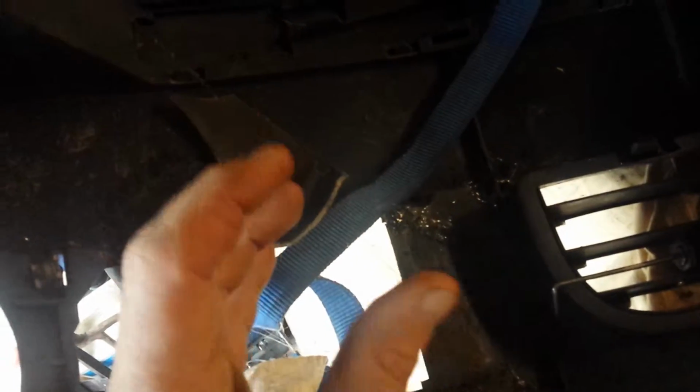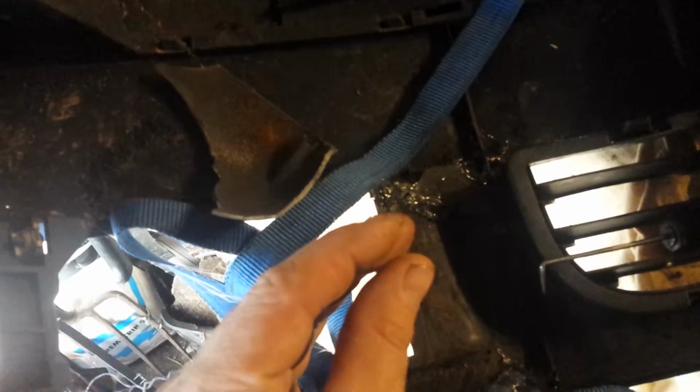And do the same again here. It was cracked all down here, all under here was cracked. The strap was there because you want to try and push these cracks together, so when you look from the front there's very little to see. I've done some that have gone back together so well you can't even see where the cracks are. So I just thought I'd show you how to repair these plastic bumpers.